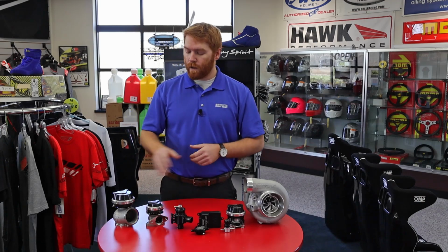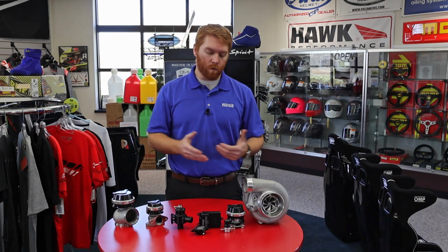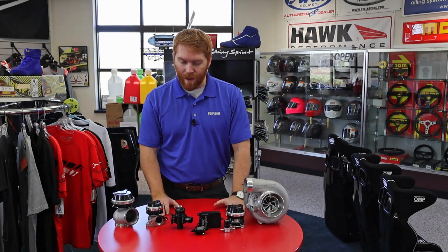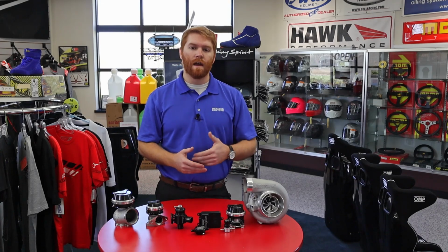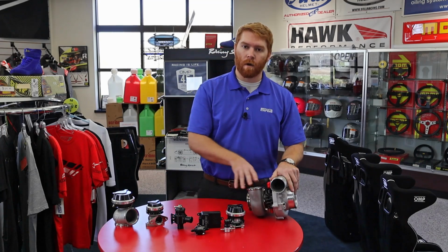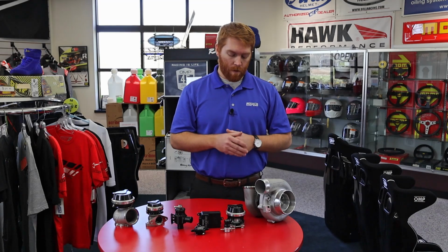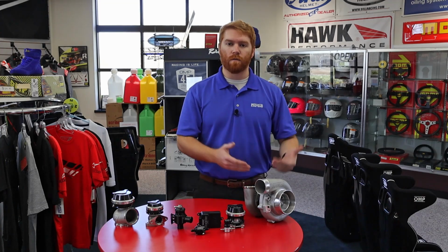But anyhow, to continue on, the reason that these are so drastically different is this is what you're using to control your boost ultimately for the most part. There are some pretty wild technologies coming out these days that are a little bit more impressive and have a much different style of controlling boost, but traditionally people use a wastegate to do that. The reason that they use a wastegate is it actually stops, or I shouldn't say stops, it diverts the air away from going into the turbine side of the turbo. The reason you want to do that is the turbine side is what actually spins the turbo shaft. That's what helps make the boost. That's what gets the shaft speed up. If you divert the air away from it, you slow down the shaft because it just doesn't have the energy, the force to go behind it.